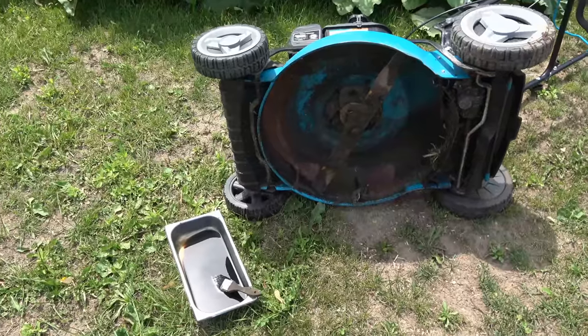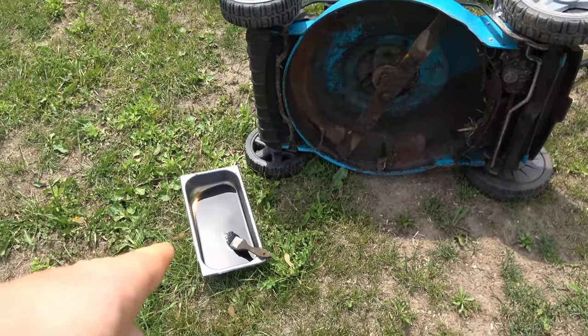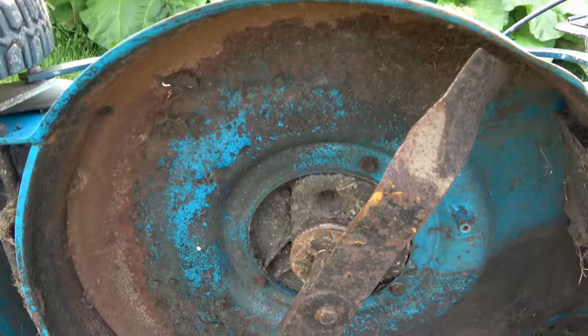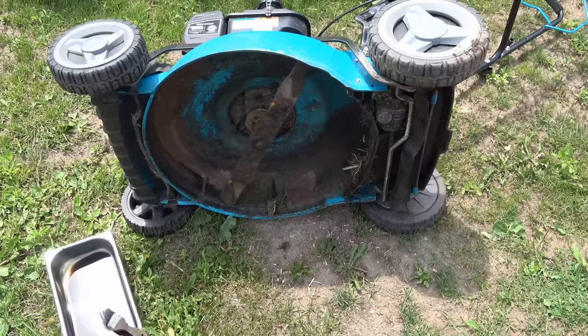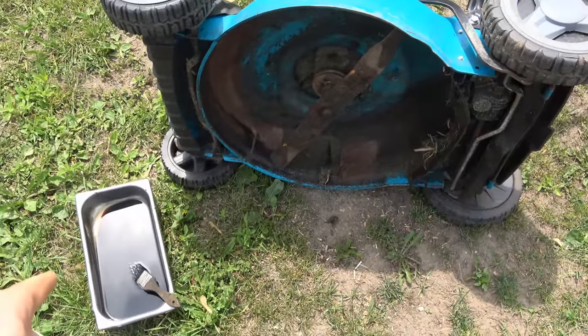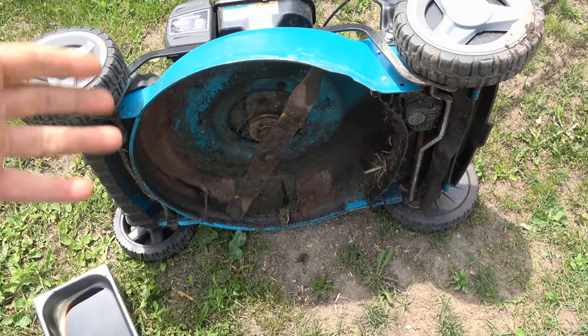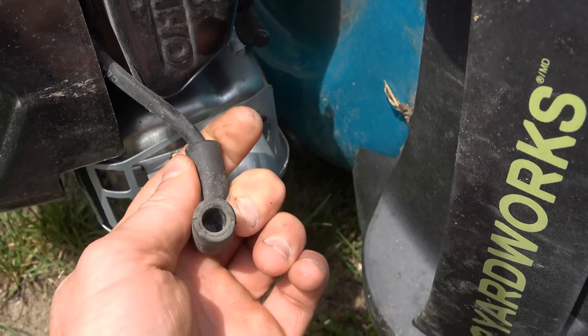What this old timer taught me is: when you drain the oil out of your machine to do an oil change, save some of that oil. Get a paintbrush, make sure you've scraped all the dirt from underneath the deck. It might be preferable to only add the oil back after you do this, just so it doesn't get into your engine and hydro-lock it. Before doing this, disconnect the spark plug for safety purposes.